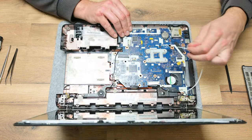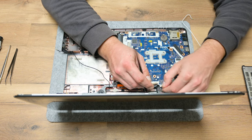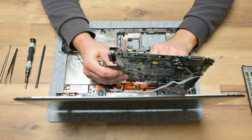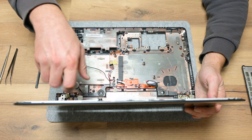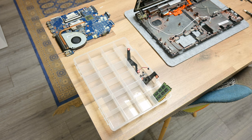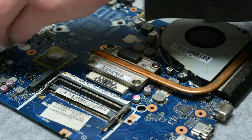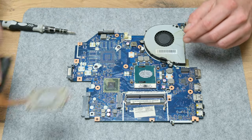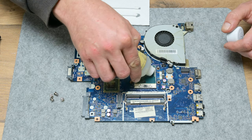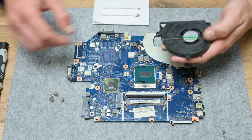But then one more thing happened — the BIOS or CMOS got bricked. We took out the BIOS chip, put it on a programming device, and loaded a new BIOS. But again, this wasn't all. The laptop worked very briefly and then went off again. At that point I had given up. But after a while, one of my friends bought some nice testing equipment, and we found out that one signal line on the motherboard was missing — connected with turning on the motherboard and waking up the hardware to start. Somehow we fixed this problem, but it wasn't over yet.